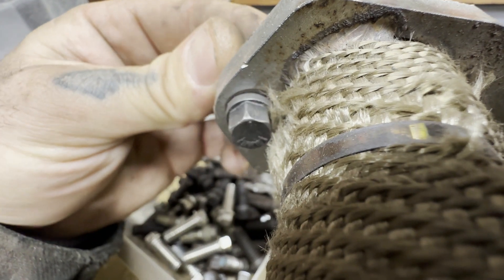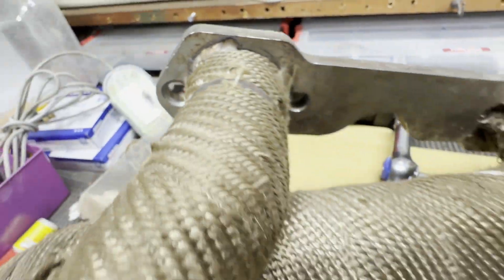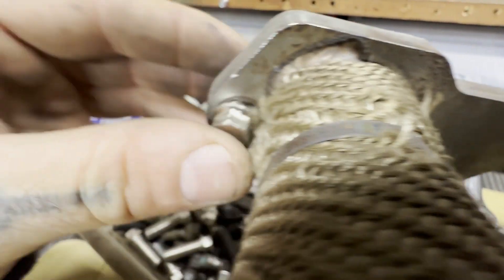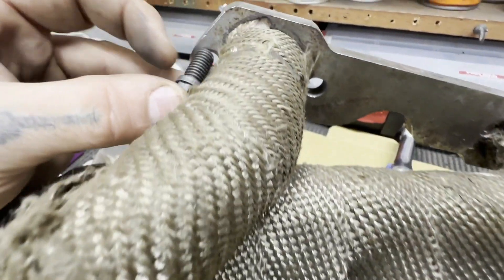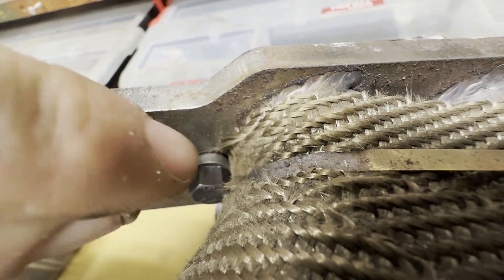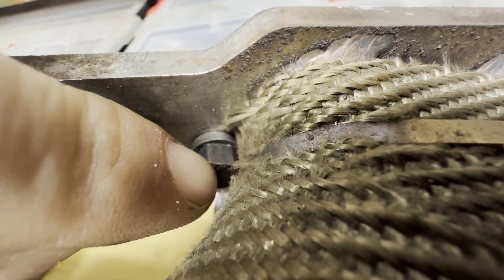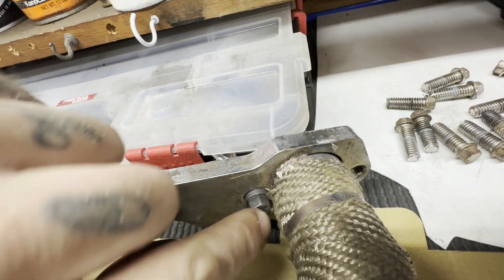I was hoping the smaller head would give me a little bit more clearance. They actually fit really nice in there, so those are probably the ones I should use. I've been using the ones with the larger head thinking that was going to get a better bite, but they seem to keep coming loose. That's probably because these might be the ones for these headers - I think they actually came with them. It's really tough to get in there with a wrench and tighten that way back in there and get it really tight. Be careful on which kind of bolts you use.